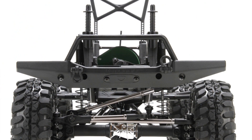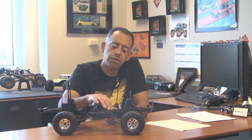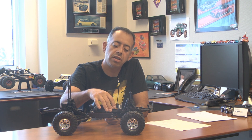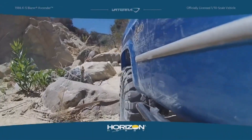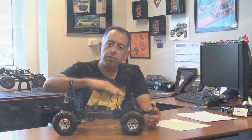In addition to that, the front and rear bumpers can be moved in and out, and the side nerf bars here can be moved outside or inside, which really helps to customize the vehicle. We've also done something pretty innovative with a battery tray that's hinged on the chassis and attached to the front axle housing. That keeps the weight of the battery on the front axle housing, providing more grip when you're climbing over rocks. It'll actually float up and down as you progress through the travel.